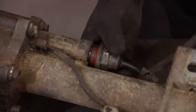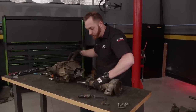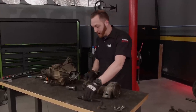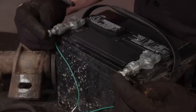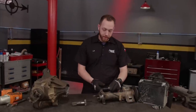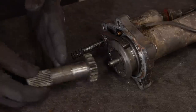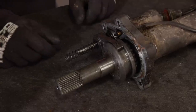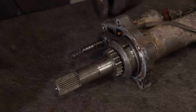This is a thermal linear actuator — it simply unscrews from the housing. A few bolts come out and the diff comes apart. Here we can see the passenger side two-piece axle disconnect system — this is what creates the link in power between the spinning wheel and the rest of the drivetrain. It's a cool combination of electronic and mechanical parts. As you apply 12 volts of power across the coil, the actuator heats up inside, expands, and pushes the rod out. When you remove power, it contracts back in. The actuator installs into the side of the housing, and as it expands the end pushes out against a shift fork. There's a small dowel on the outside axle shaft that centers the inside, and as the shift fork extends, a collar slides over the splined areas of both parts of the axle, engaging four-wheel drive. When you disengage it, a spring pushes the shift fork back, releasing the collar. Finally, there's a small switch that tells the dashboard light when four-wheel drive is engaged.